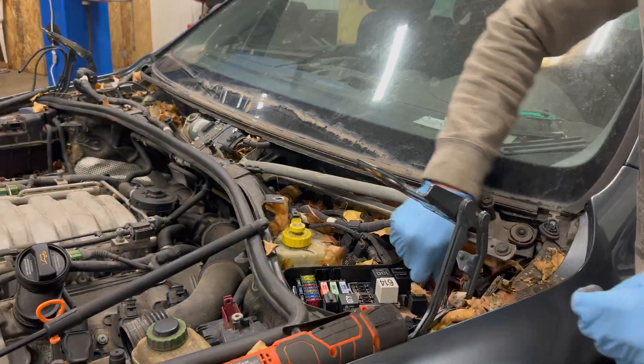Okay, the good news is that we have a timing — a very, very loose timing belt. I decided to take the timing covers off just for peace of mind to see what the belt is like. While the water pump and belt tensioner do look new, we have quite a lot of timing belt play. A lot. I'm not entirely sure what that means yet, but it's definitely very concerning. I really, really hope that this motor has not skipped time — that would be very disappointing. The previous owner did say he's driven this thing. I guess we're just going to worry about this after we pull the motor out.